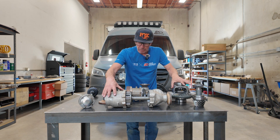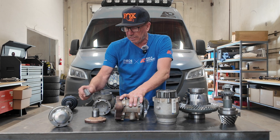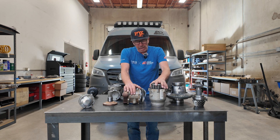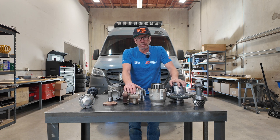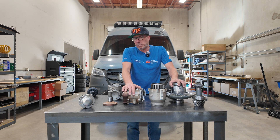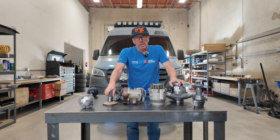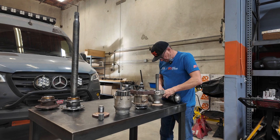Look at the difference in size of these components — a lot of stuff going on here. Surprisingly the only part that broke was a fairly seemingly simple part. You would have thought maybe this planetary gear would have imploded, as small as these components are. I have a feeling that over the years we might see more breaks coming out of these differentials and we'll address them as they come up. But so far we've had four Atlases in the field for some time running 4.20 and 4.18 gears with this 4.20 front end — it's been pretty easy. This one did come out of an Atlas build; we put another one back in and it's back on the trail running the Atlas with no issues. We'll keep an eye out, but it's super cool to see all these components and how they work.